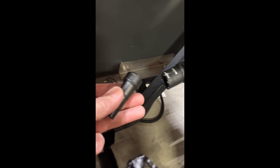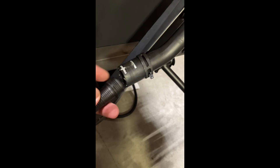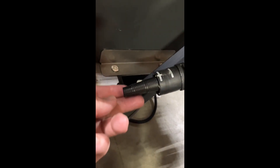When you hook up the cooling lines, start on the right-hand side — that's your lower hose. You'll get reducers in the kit. If it's an older bike, clean out the inside of that pipe and maybe put a little silicone on it. Slide it up in there and clamp it — the reused spring clamps work just fine. You'll also get some screw-type clamps in the kit. Then get your clear line that comes with it and run it from the lower hose up into the front of the motor.